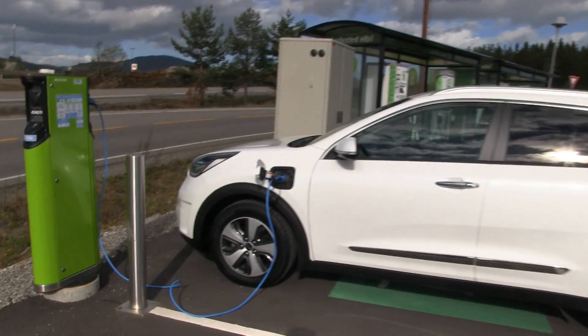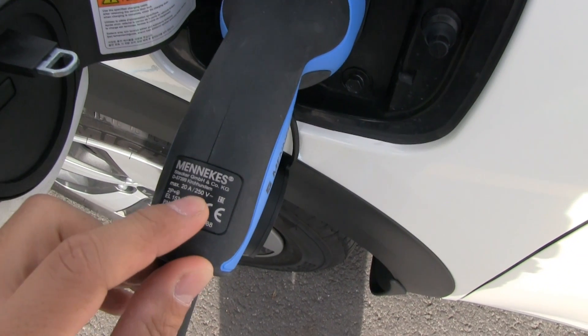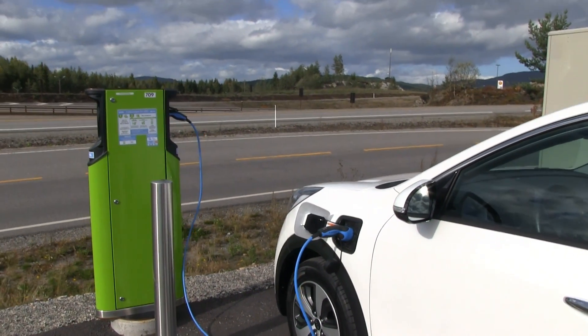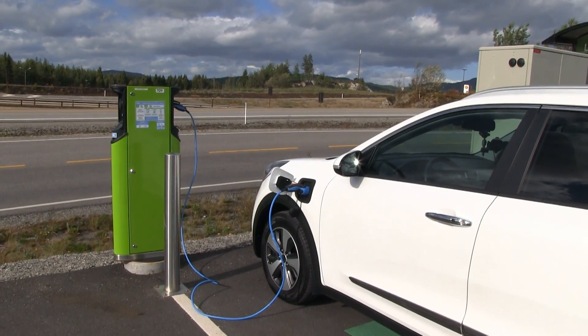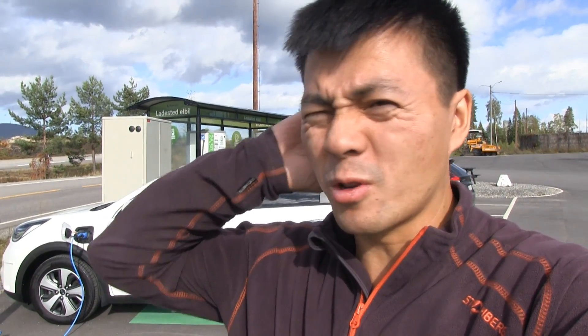The cable that comes with the car is very thin - maximum 20 amps - and I bet this car only has a 3.7 kilowatt onboard charger. 7.4 kilowatt would be better because it will take over two hours to fully charge from empty. It seems like when you drive it, it also charges up the battery. I do the 90 kilometers per hour range test because it seems to mimic typical driving conditions and match the WLTP range pretty well.